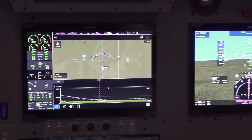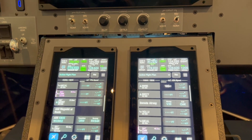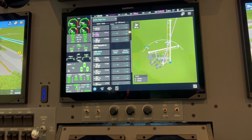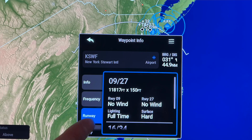Completely redesigned from the G3000. Prime offers touch primarily on every screen. Having an interface that is touchable makes things a little bit bigger. G3000 Prime introduces new hardware on the primary windows where you're viewing the information, and brand new hardware down here where we used to have Garmin touch controllers — these are now secondary display units. G3000 Prime is faster on the back end with touch capability and an intuitive user interface that really emphasizes the ability to touch things.